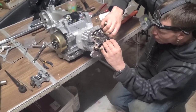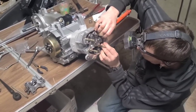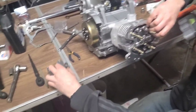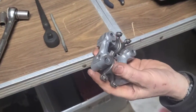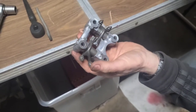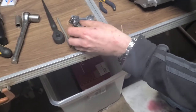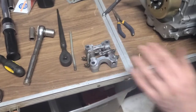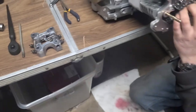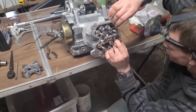We found that these four valve are almost like the same thing as the two valve in a way. The cams are the same. Just look at the rocker arm, here's a real difference. It's made just like the Yamaha Zuma 125 motors. They have the same design head. That's cool. Yeah, they're identical. I've seen that actually. Yeah, the Yamaha Zuma, the Cygnus head. Identical. But they have these extra little things out here. It's crazy, but that's how they're doing that.